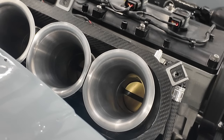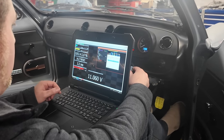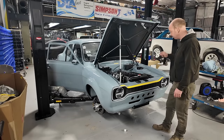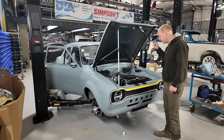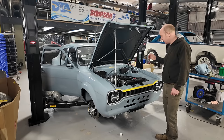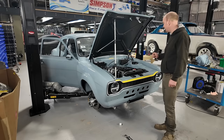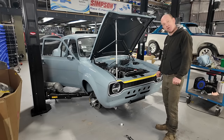Further complications: we have a very minor fuel leak from a connection on the fuel rail — it appears to be a bolt with either a tiny dink in the seat or an incorrectly machined seat. We're using a link pipe to determine which side of the union it's coming from. We also had an alternator charging issue — the alternator is on flexible bushes and therefore has no earth path to the engine block, which we'd all overlooked. Now rectified.